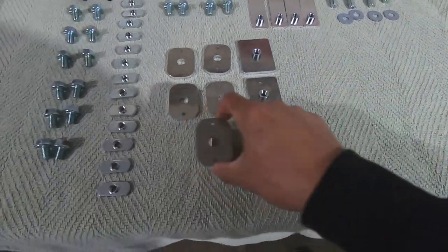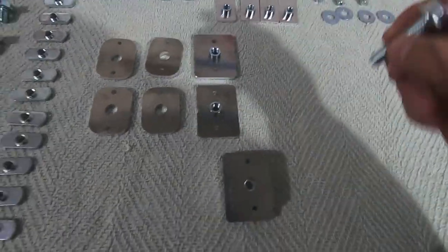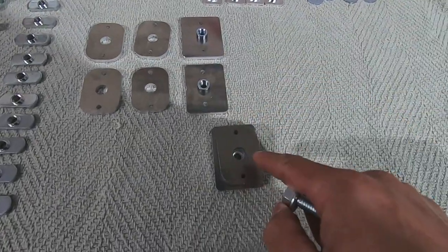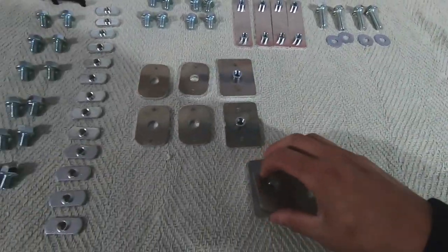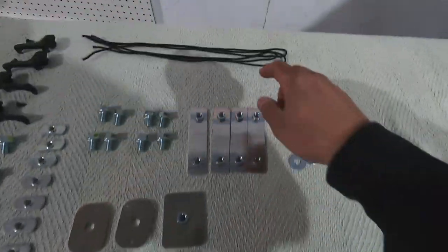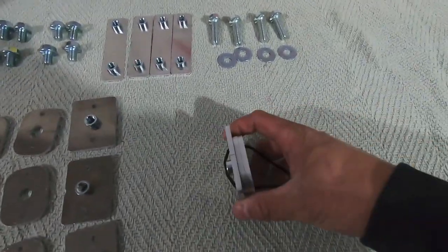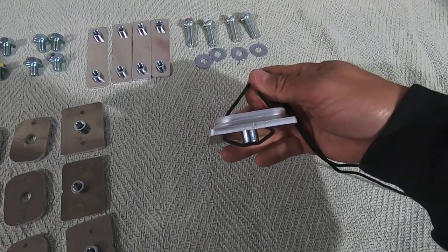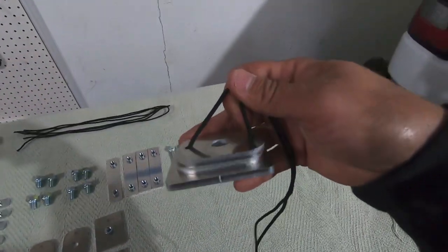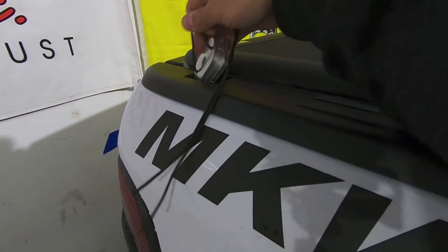So what's going to happen is you're going to assemble these guys. You're going to have the two spacers on top. This is going to drop to the channel, and then it's going to mount to that guy. So I have one of the stakehole pockets I've assembled. So they give you a bunch of string, and the reason they do that and the reason they have drilled holes here is this is how you install these guys in each of the stakehole pockets. So you basically string them up, and then after you trim everything down, you're going to use the string to help you with lowering these guys down into place.